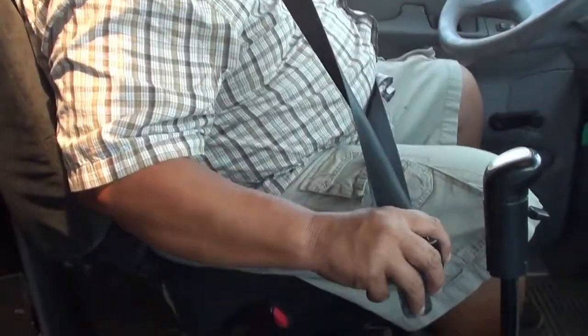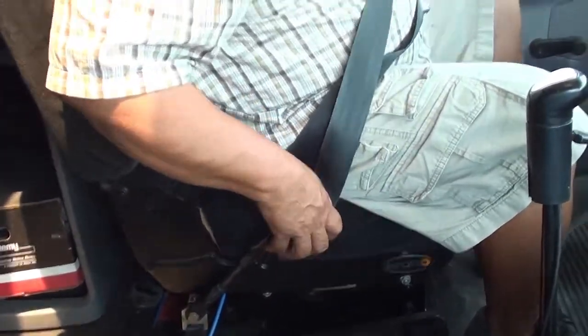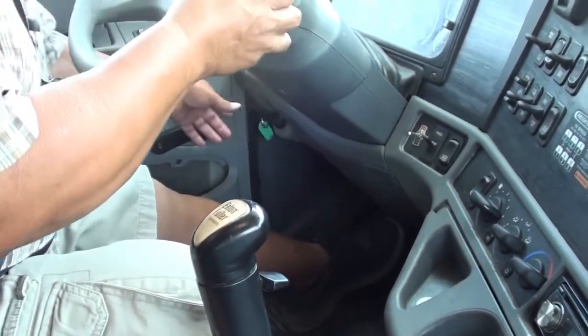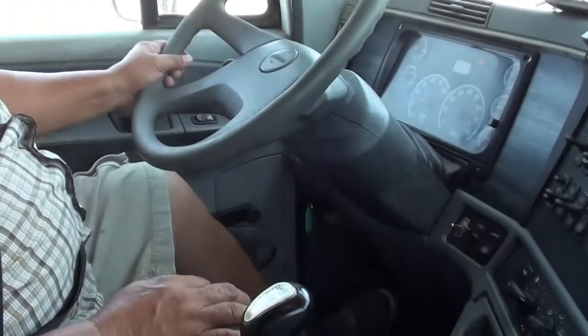Go. So I'm gonna start with my in-cab. The first thing I need to tell the examiner is that I came in with a three-point contact. My seatbelt: properly mounted, secure, not broken or damaged, no missing hardware, make sure it's working properly. And then you're gonna do a safe start. Safe start means that you push the clutch, you want to make sure you're in neutral, and you turn the engine on. You can release the clutch.